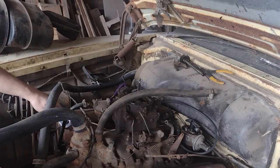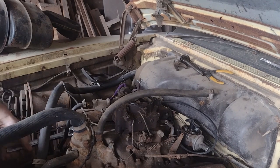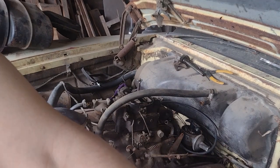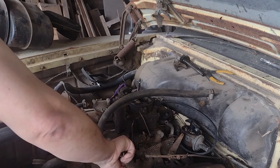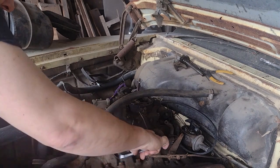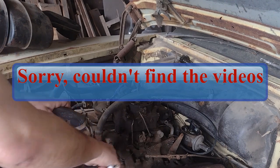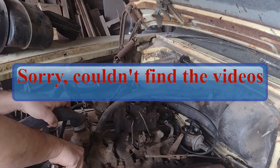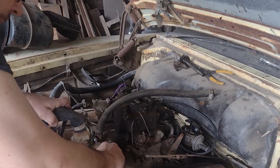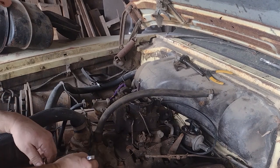And I actually tore this engine down and found the offending piston cylinder that was pushing oil. Freed those stuck rings because my dad accidentally overheated it, and got it running again. But now, as you saw in the videos I showed you, I had to have this thing towed home from the last show I went to in Henderson. I don't remember what date it was. Hopefully, I'll add that in the description. Let's see when.